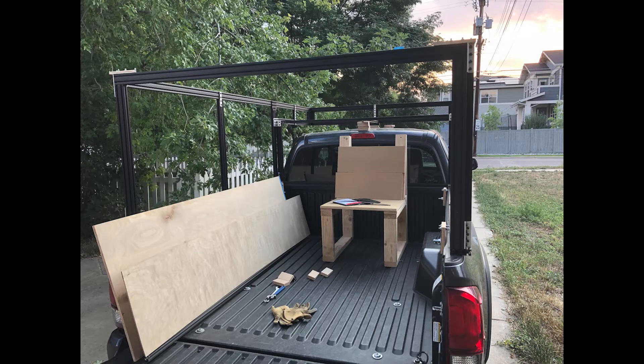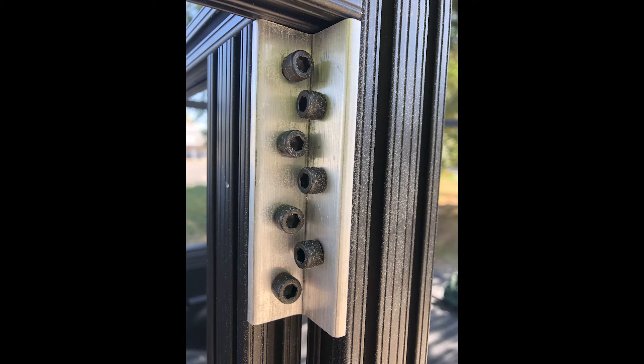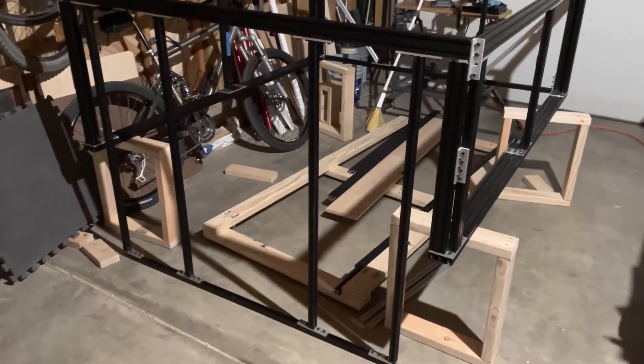Here's the prototype chair I was talking about earlier. This is a special bracket I made on the very front of the camper on the over-cab part — it's made out of 3/16 angle and just holds everything together. There's also a bracket using the same concept on all the posts. Here's a test to see how the window looked in the camper — it's a little short for that opening because I had already decided to cut down the camper. This shows the size at that point.